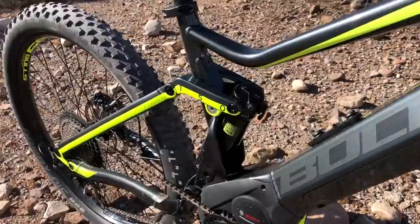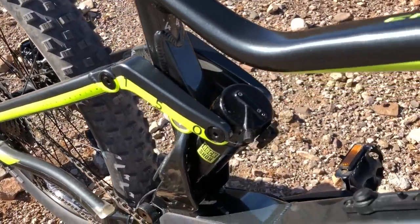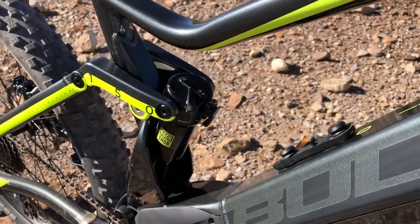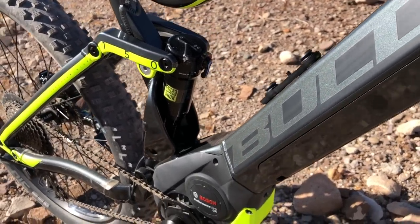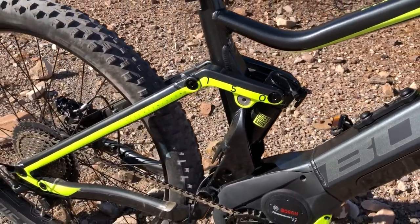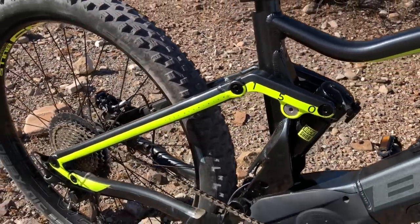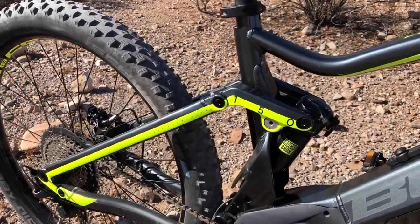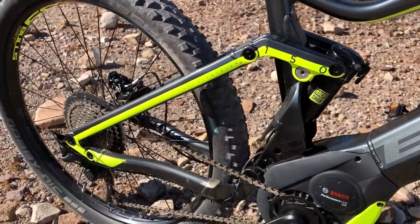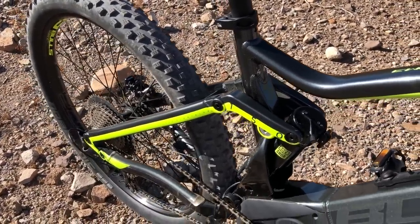Let's take a closer look at the rear suspension design. You've got 150 millimeters or 5.9 inches of rear suspension travel using the RockShox Deluxe RT rear shock. The air spring can be adjusted to fit your riding weight and style, and there are damping adjustments and a lockout — the lockout minimizes suspension travel on smoother roads, while the open position provides the full suspension effect. The pivot points are quite large and the overall suspension feel is very smooth.